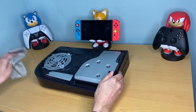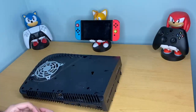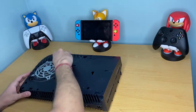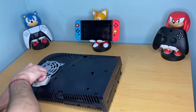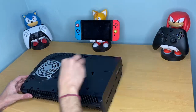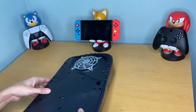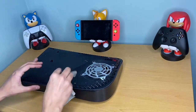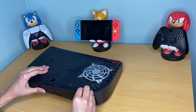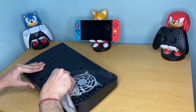Swapping to the other side, you can see the dust usually picks up more around the fan area - that's where all the action happens. Clean from the outside so it doesn't push back into the fans, because that's only going to do more damage to your PS5. You can use compressed air at this point or a mini vacuum, but I prefer to use a microfiber cloth. Give it a good clean, getting into all the little nooks and crannies.